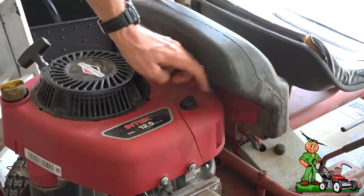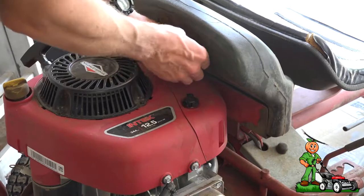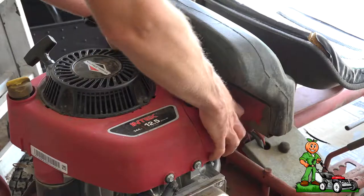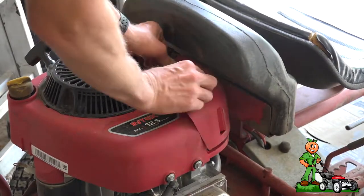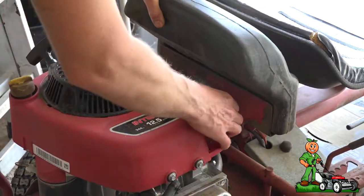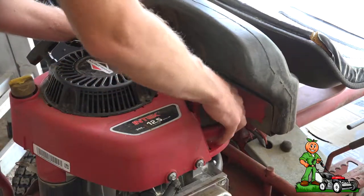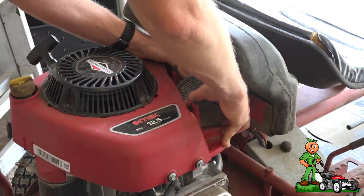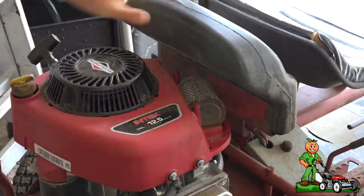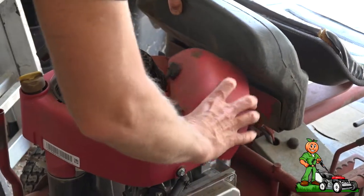The first thing I'm going to do is check the air filter. On this model I'm just going to remove these two screws and two bolts. We've got a cartridge-style automotive filter here and it still looks just fine and serviceable. Depending on how yours looks, you may want to replace it — this one is going to go another season.